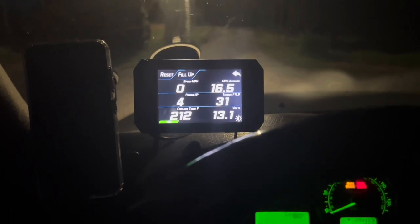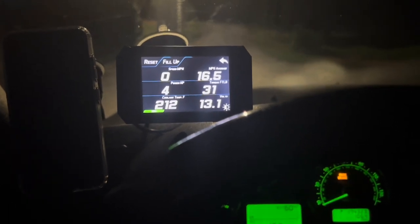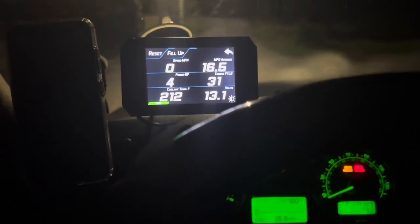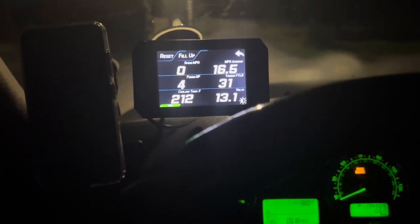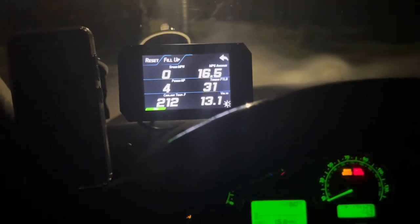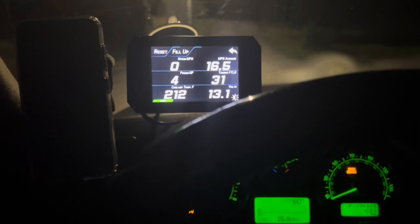And then I did all this driving, and occasionally I would pull over and monitor to see where the temperature was at. For the longest time, it would only be anywhere from 217 degrees to 219. It was fluctuating between that, at a constant, maybe when the fans kick on it would be 217, without the fans kicking on, 219. But the biggest I've seen it was a lot later on in the day, which was 221.